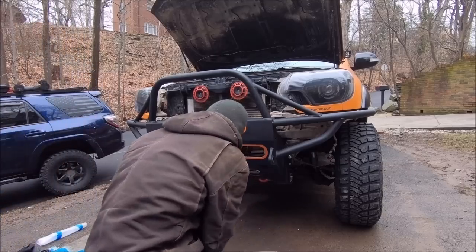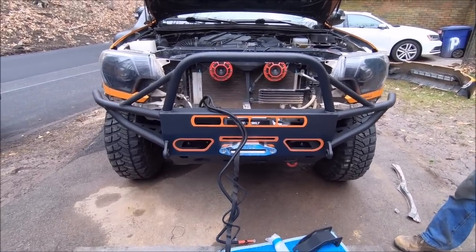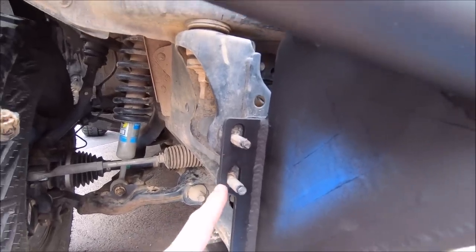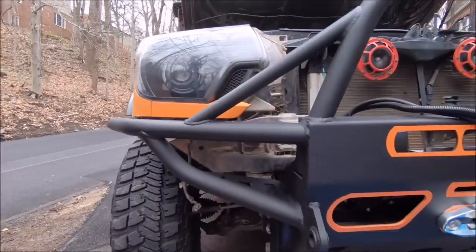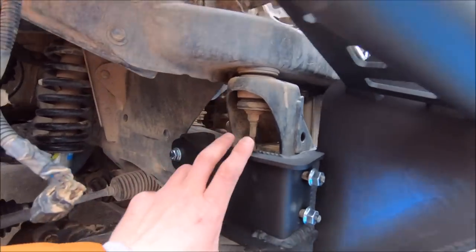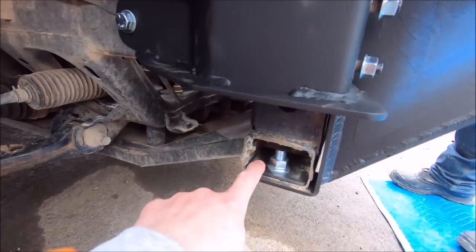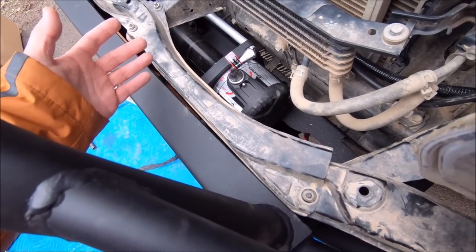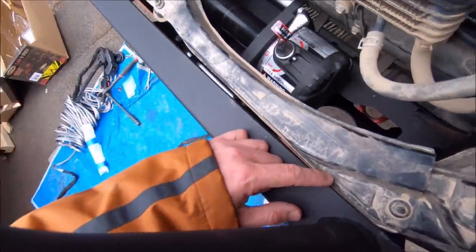The bumper's on there. We put on the three flange nuts that were holding the aluminum crash bar. The slots on the bumper give you about a half inch of play so you can adjust the bumper up or down. I just use the bottom of that lower eyelid to get it even on both sides. Getting ready to tighten down the three flange nuts — you can see the support piece on the side goes from there to the back of the frame. There's also a square piece that goes in here on the bottom on both sides. It was tight but we were able to get that piece in — looks like about an eighth of an inch clearance on either side. Now just putting the grille back in and getting everything buttoned up.